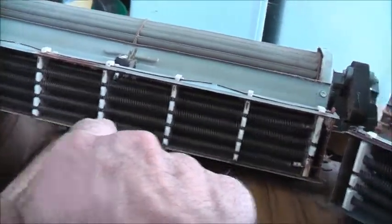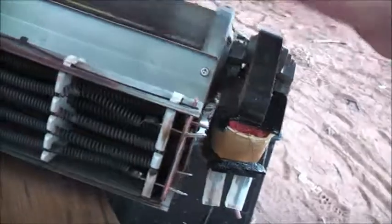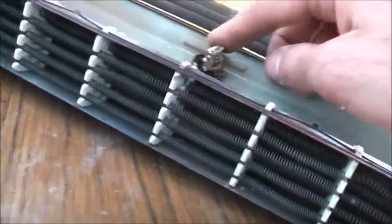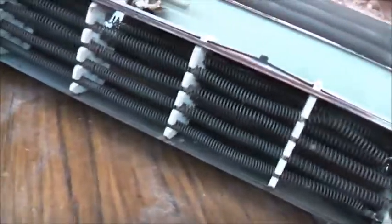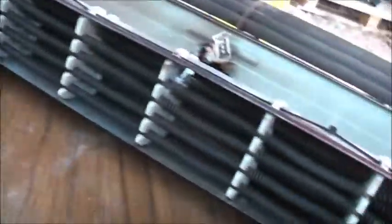Postmortem autopsy revealed - look at this heating element and how easy that is to turn. As you can see, they're all nice and straight and in good condition. You can see this one - they've blackened and they've sagged. So that tells me this thing has gotten very hot and overheated. So this was the culprit. That's either slowing down and not pushing enough air past the heating element, or seizing up altogether - and that would have overheated. And somehow this thermostat may have either been too slow or failed completely, because that's supposed to cut out and stop the heat - it would rise and shut that off, open the circuit, and that turns the heating element off. For some reason, this one didn't do that. So either it got too hot too quickly, tripped out and kept re-setting, and no one was home to see that it was actually overheating.